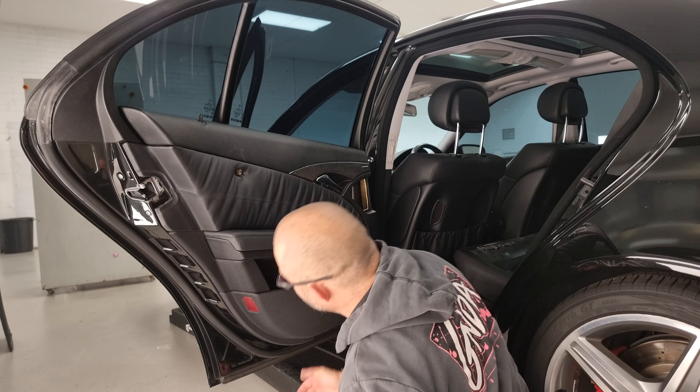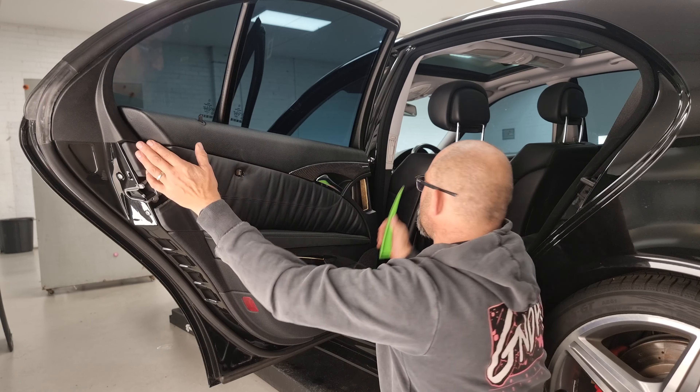It's quite a simple door trim this. Easiest way to do it is follow through down this right-hand side. Pop your trim tool in here and then just on this bottom corner try and get the trim in behind the actual trim - you don't want to really separate this speaker cover from the door trim - so make sure you get right in behind and just pop evenly.